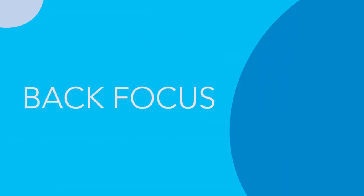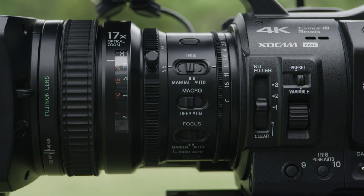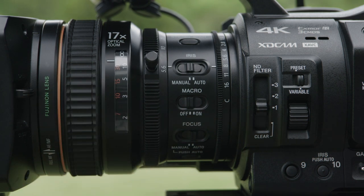One of the first things you need to do when your Z280 arrives is to check the back focus. Your camera has traveled thousands of miles on its way to your doorstep. It may have been bumped and jostled along the way and was probably subjected to extreme temperatures — all good reasons why you need to check the back focus as soon as possible. If you're an experienced camera operator who has used ENG cameras in the past, you already know this procedure is mandatory for new cameras, new lenses, and equipment that has traveled long distances. To check the back focus on your Z280, just follow these steps. First, put the camera in full manual focus mode by sliding the focus ring on the lens to the rear position. You'll see the words "Full MF" in the viewfinder.